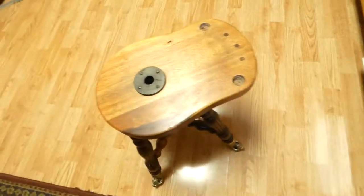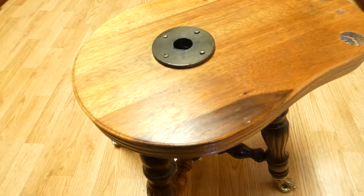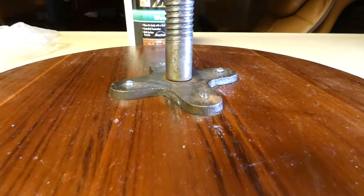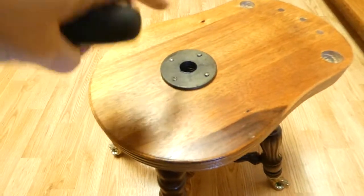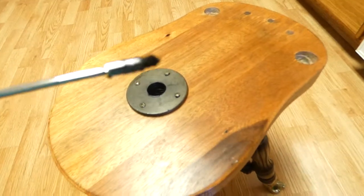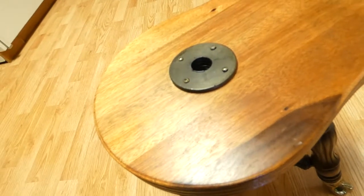First thing — it was kind of whining when I would spin it. The top spun around and didn't come out, and I think the people donated it for that reason. So I took some pliers and got the screw part out. The top was spinning around, this part was secure, but this part was loose and spinning around. So I unscrewed it all the way, pulled it out, and then I put a magnetic thing down in there and pulled out all the shards of metal — it was scraping and making noises because it hadn't been oiled in many years.